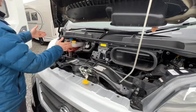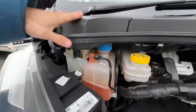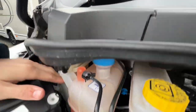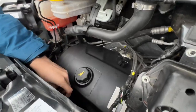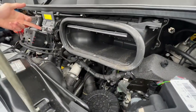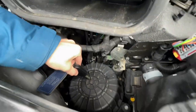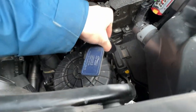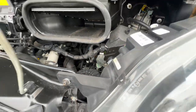All your fluids are inside the engine bay: starting off with screen wash, then power steering fluid, coolant, brake fluid, oil and oil filler. To give or receive a jump start, this is your earth. And by the side, the air filter — if you put your key in here and lift it up, this is your positive terminal for giving or receiving a jump start.